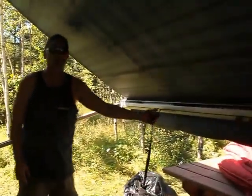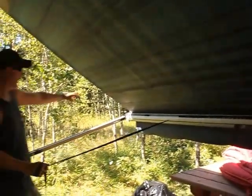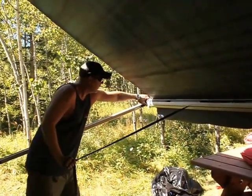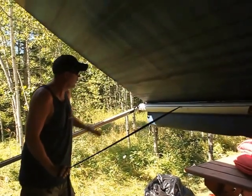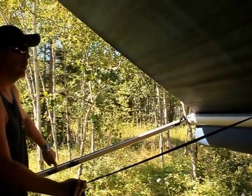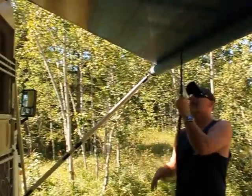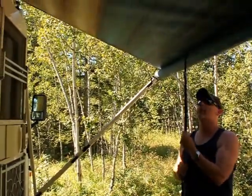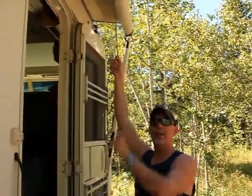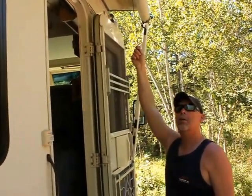The awning is ready to close. We're going to hold the strap — it's nice if you do this with two people. Hold the strap, make sure it's tight. Pull this lever up here, pull it down towards this way. You have to pull it pretty hard. When you pull it, you can see this whole lever goes down and the orange marker here goes away from down here. I'm going to slowly release this up, making sure you don't let it go because it will slam really hard into the motor. When it gets to about here, I stop — this is probably as high as you can reach, looks like it's about a foot off. What I do now is just let it go.